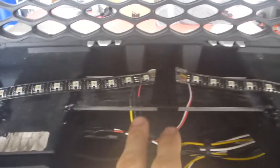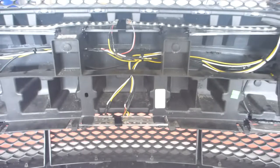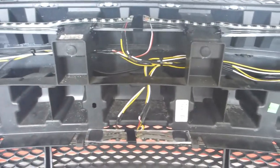Because these are addressable strips, I can't just run one continuous strip across the entire thing — I have to do a left and a right channel. You can see this electrical tape right here; this again is a strain relief. Strain relief is always very important because vehicles are vibratey things. Everything is going to be subjected to excessive vibration and you have to design and install according to that.